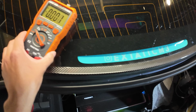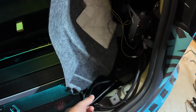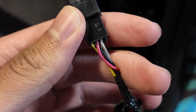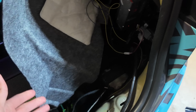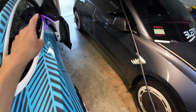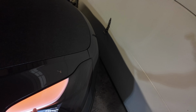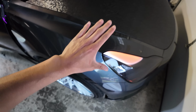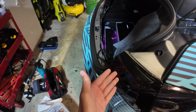And we're using the multimeter to see basically how it gets powered, because this, by the way guys, is not color coded correctly. If you guess red is hot, you're wrong. It's not. So the first step that we're going to do is turn on the running daytime lights or parking lights. You can see that they're on right now. Now that these are on, we are also sending power to these lights, and then also to the rear tail lights. They're just not lit because they're not.